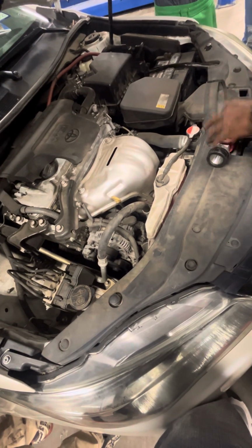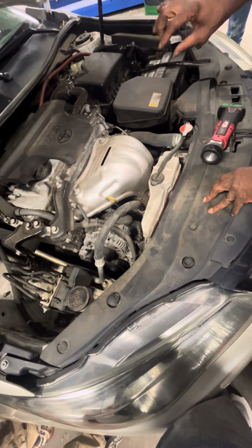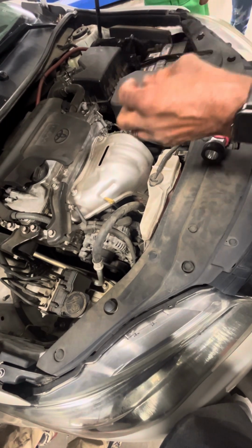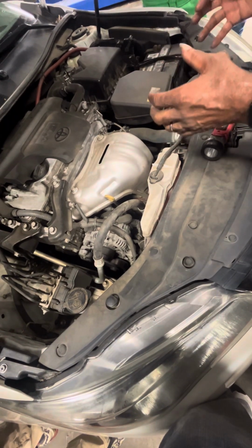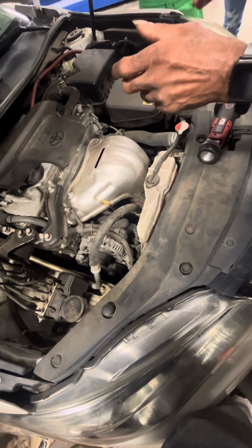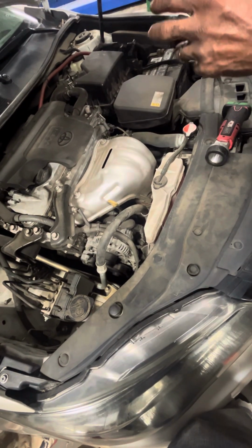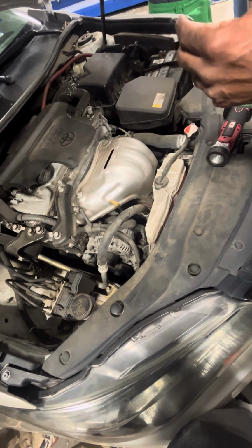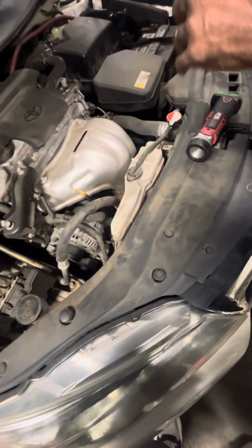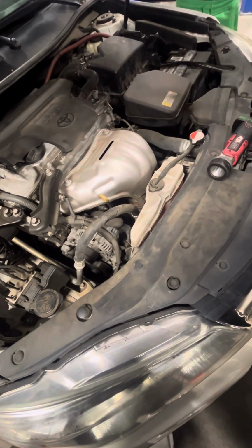And if people have a leak and they put that powder stop leak in it, it is designed to block off any kind of small passage that could be leaking. The radiator is full of small passageways. Y'all are aware of that, right? Y'all have seen a radiator? I have one over there we can look at if y'all want to study it. But the radiator is full of small passageways, and that stop leak can block off half the radiator. Then only half the radiator will be working or allowing circulation.